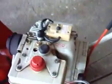I started it yesterday and it runs real good, except when you put gas in it, it would just all leak out the carburetor over there. So I installed a new fuel line and a new cutoff switch. So when I'm done, just turn it off and it won't leak. That's a waste of money when it leaks gas and it stinks up my shop.